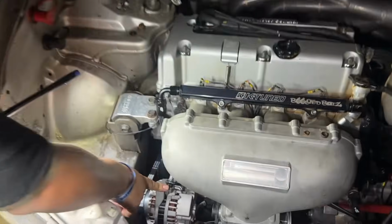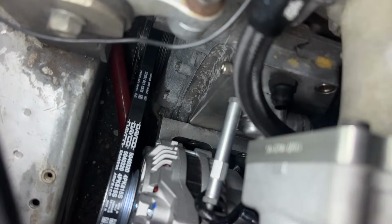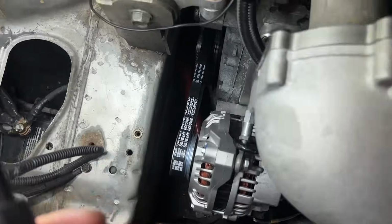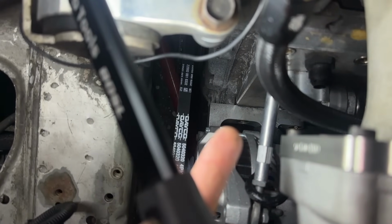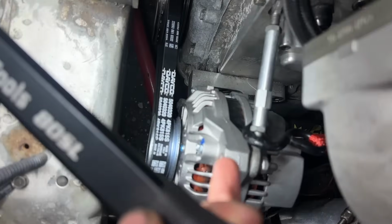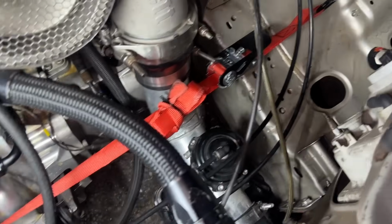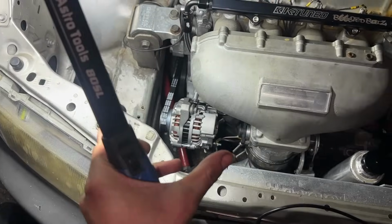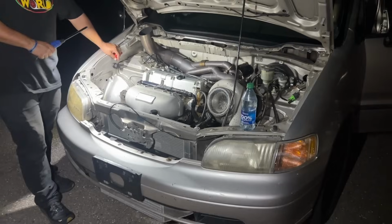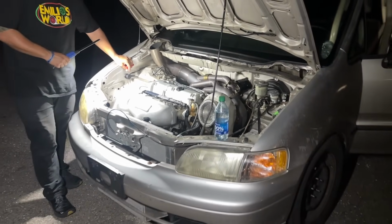So, man, we also found out that our alternator bracket is cracked. See that crack right there, guys, on the billet aluminum deal? So the alternator was starting to tilt to this side. There's only one bolt holding that lower bracket on now. It's that bolt right there. So now this one's not doing anything. The belt walked, and I put a ratchet strap on the top of this, and that runs all the way over there just to help keep the alternator from tweaking when it's running. So we're trying to make it all the way. We only got 2 more hours to go, and we got to break the beams, and we have completed Sick Week in the Odyssey. Day 4's been rough. Time to hit the road for the final stretch of Sick Week.